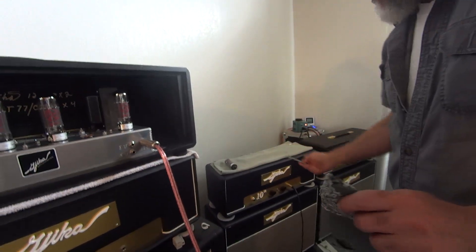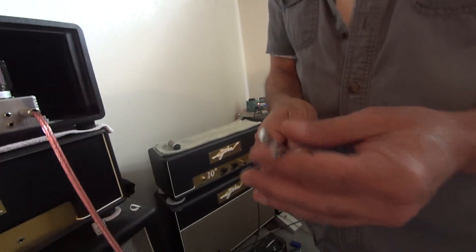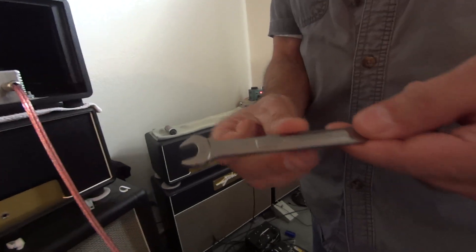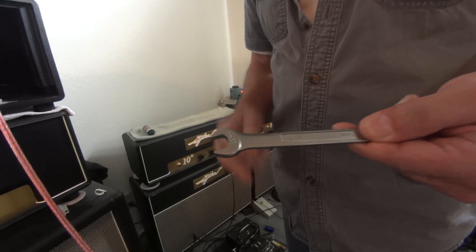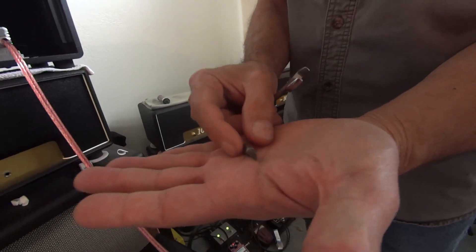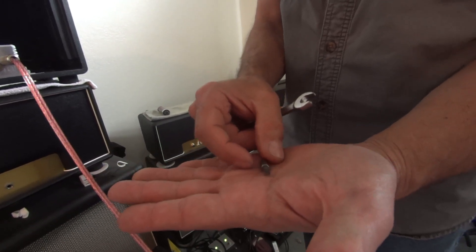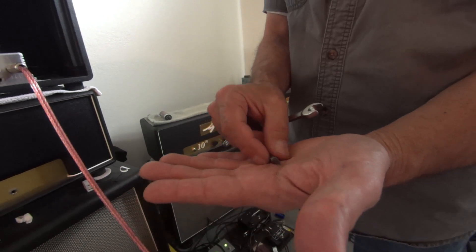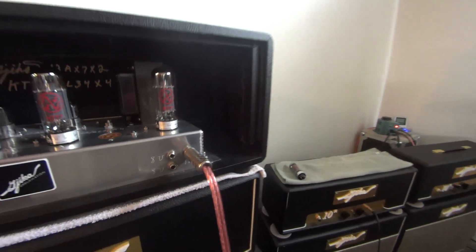You don't need to be a tech to do this. The tools you need are simple: an 11-millimeter open-end wrench — you might need to go buy one, it's a couple of bucks — and a small flat-head screwdriver. A screwdriver set like a standard eyeglass-size set works fine; just note you have limited room in there.